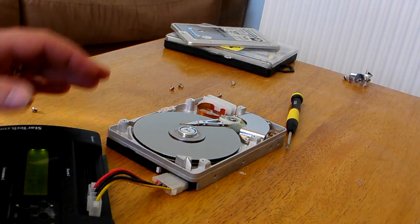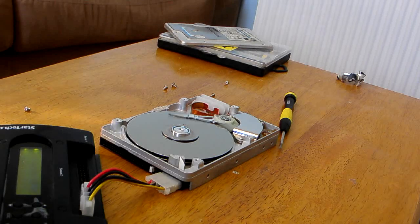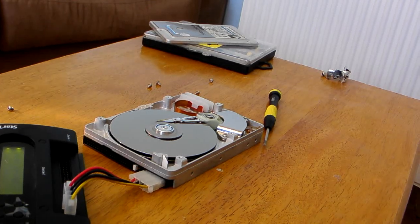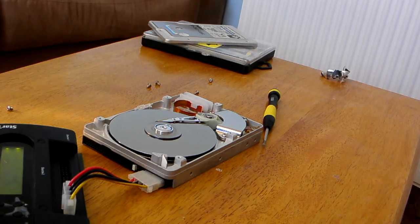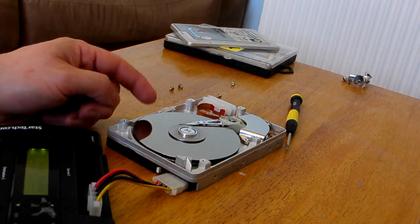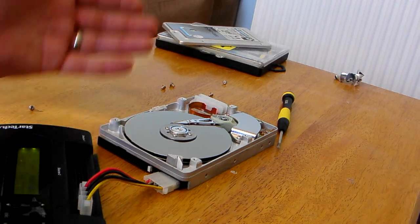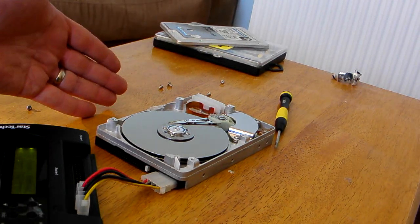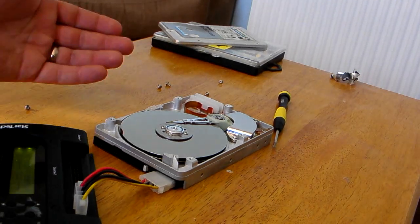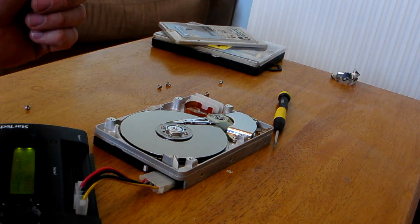Because this sort of trouble was happening with different brands of hard drives, what they came up with was a self-diagnostics tool called SMART. SMART is the self-monitoring analysis and diagnostic tool — I've gotten it somewhat wrong, but you can look that up, it's not hard to find. Basically, the SMART software checks the hard drive all the time. For example, that hard drive there has had trouble spinning up. If it did spin up after all those attempts, it would come up with a SMART drive failure warning, telling you it's attempted to spin up X amount of times and really needs to be replaced. The idea would be to save the data and then replace the hard drive.